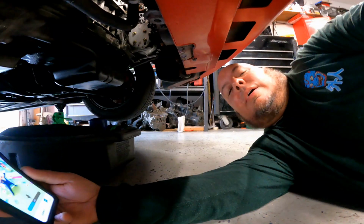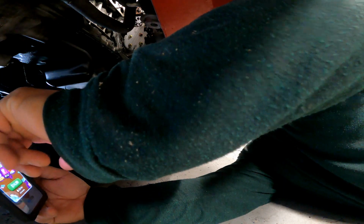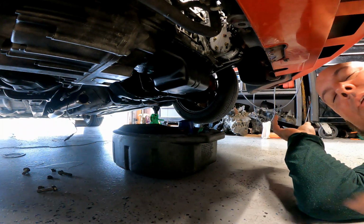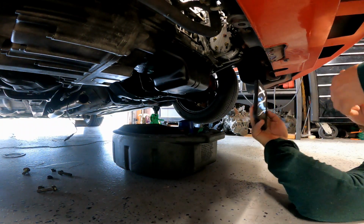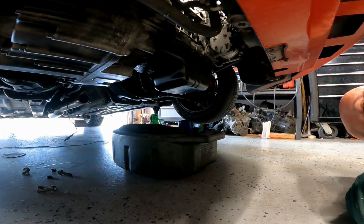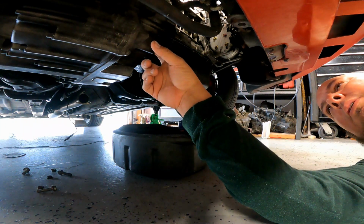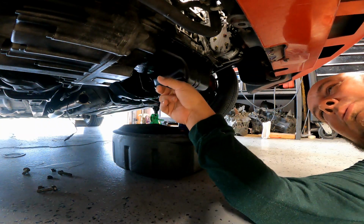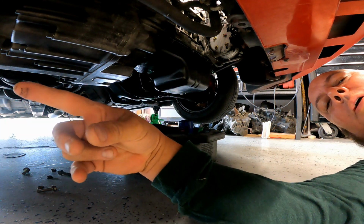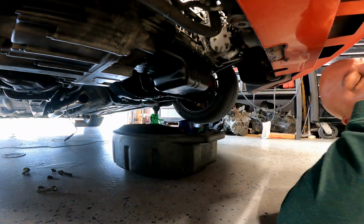All right, guys. They forgot something in the store, so we want to get it. I am draining the oil pan right now. It's draining the oil pan, waiting for that to go through, and after that I'm going to grab it and take it apart. I'm going to take the safety bolt, the transmission plate off, it's missing a bolt already, and I'm going to take these three off, then take all these out, and take the oil pan to get washed. And then when you come back, we can put a new one in and put all that clean up.